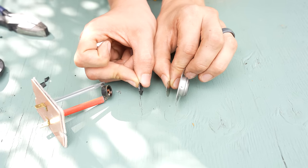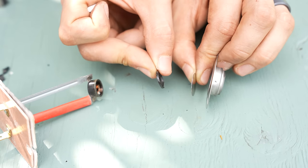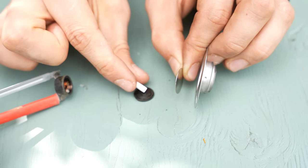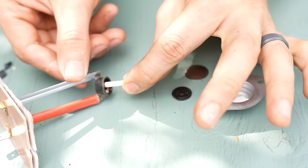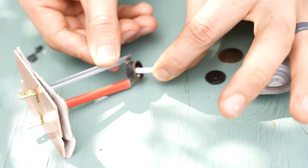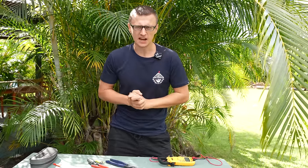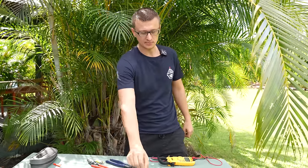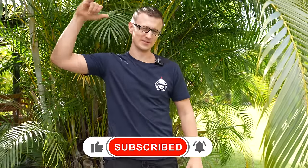In summary, if we line up all the insides, this is what it looks like: you've got the outside case, then the snap disc, usually a little plastic part where the little rod sticks into, and then that little rod goes to the contacts. Once the snap disc opens, it opens up those contacts and interrupts the power. Well guys, that is all I had for you. Hopefully you learned some new things about the limit switch, how it works, and what the insides look like. Thank you so much for joining me on this video — if you enjoyed it, don't forget to mash that like button and I'll see you next time.